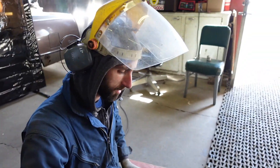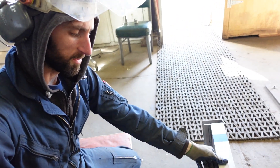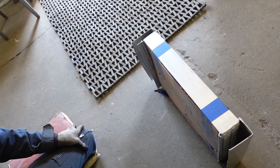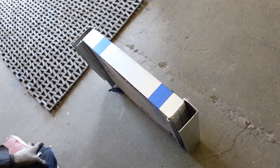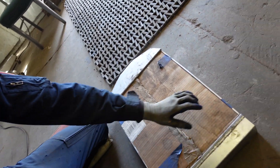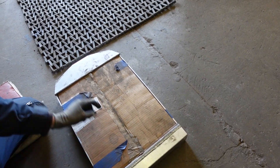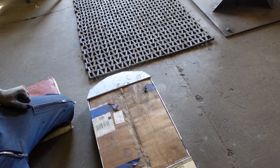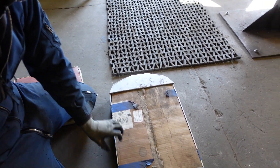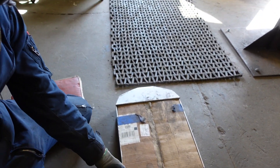I'm going to show you a little bit of the work on this radiator as I'm doing it, because these are kind of mysterious things if you don't know exactly what they're made of or how they're made — you have to modify them quite often. Basically it's just got cardboard on it. I'm going to cut these housings off, bend some more metal, put new caps on the end of it, and change the side piece to have a mount.